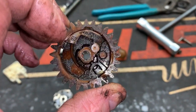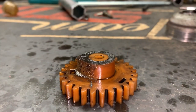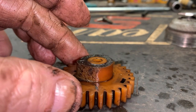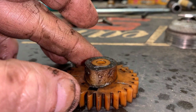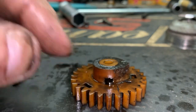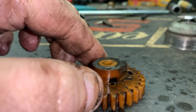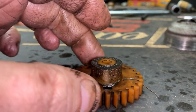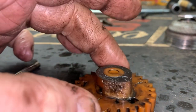The camshaft can't work because the spring that operates it usually fails, overheats, and then the spring just disintegrates. So what does little Johnny do down at your local lawnmower repair shop? He tightens those valves down to where there is just absolutely zero lash trying to get this camshaft to work correctly — and it's just not a good scenario. When you run those valves down that tight, it melts the camshaft.